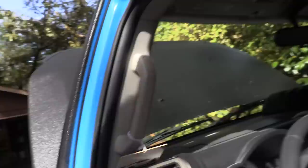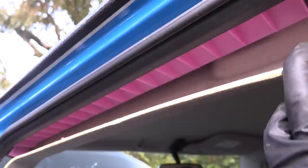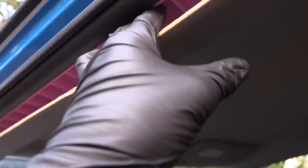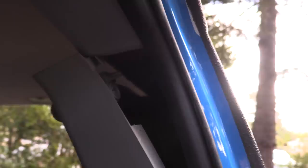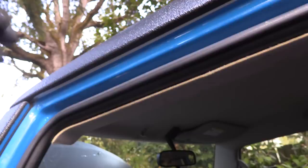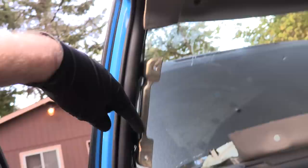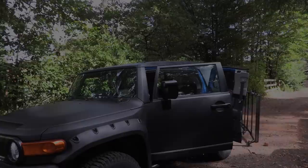I'm going to feed the wires through under the headliner and into the A-pillar. To do that I'll take off all the paneling, sun visor, and things attaching the headliner to the roof going all the way back. I checked for wires before drilling and we're all good - there's just a piece of plastic and in the back there's a whole lot of nothing. I peeked under the headliner until I could see light through the bolt holes for the roof rack. Now I'll hop on top, drill the holes, place the roof rack, run the wires from the back under the headliner up to the front, down the A-pillar, and into the engine bay.